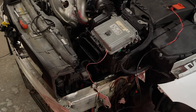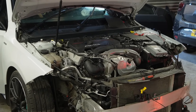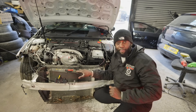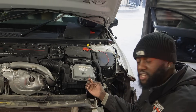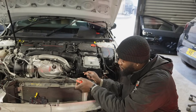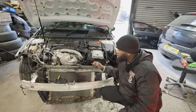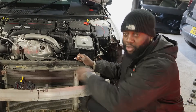The car did make a noise — so it should start. The engine is running! But let me show you what happens when I remove that tether. As soon as I remove the tether, the engine cuts out — that's exactly what happened when it shorted last night. So the ECU is in place, earthed, tethered to the body of the car. That way we can at least move the car in and out of the garage. If any of you think you know what the problem could be, let me know in the comments. Let's continue to pull the chassis.